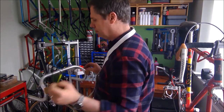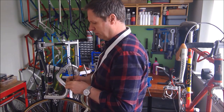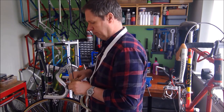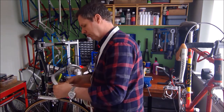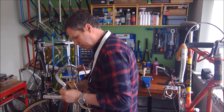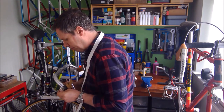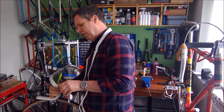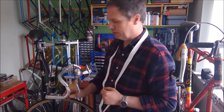This little bit of finishing tape, just pull the lever hoods back, fold them back over, peel that tape off, and stick that nice and equally, covering the back of that lever bracket. And I generally just push the hood back over, and that just keeps that in place nicely. There you go, covering the back of the lever.